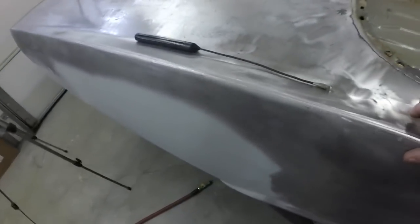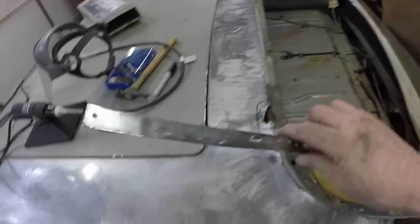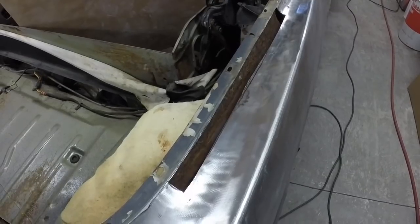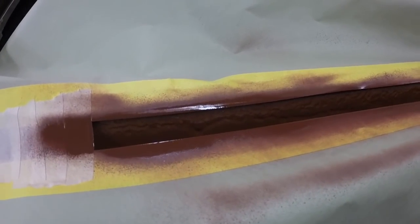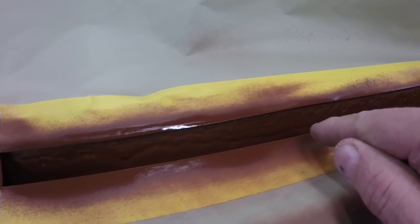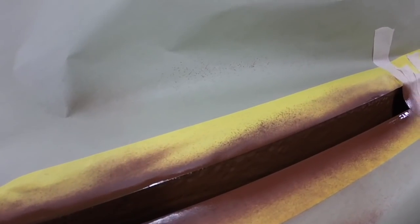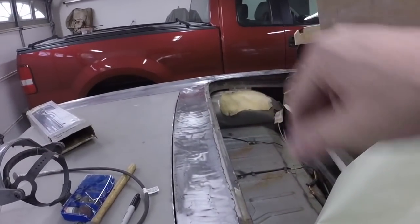This is my template — I'm going to use it to form the metal. It's all formed the way it should be. I got a piece from my dad's house to use as a pattern — that's a valance for between the bumper and the grill; I've got to paint that silver. I spent quite a while sanding that out and primed it with Rust-Oleum Rusty Metal Primer, and I'm going to paint it with Rust-Oleum too. While I'm repairing this hole, I'm going to repair all this over here too — repair this side in one shot, then go over and repair the other side.